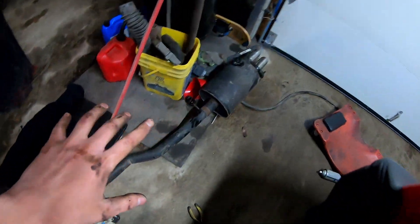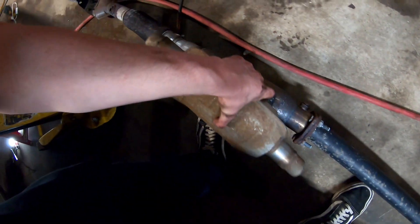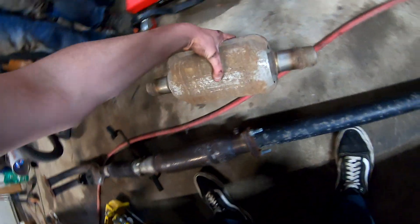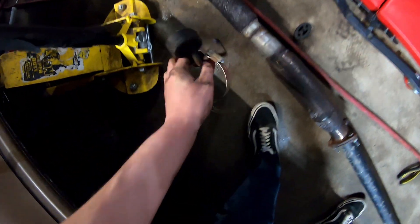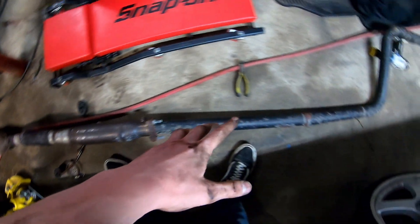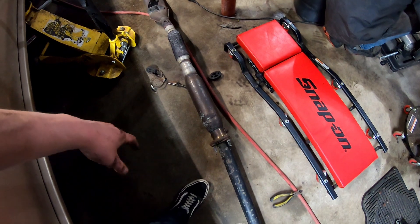The exhaust is fully out of the car. We're going to fix a few little issues while we're at it. This is what we're putting in — and that's actually like the right length, cool. Going to put a cat in — I never thought I'd say that. This hanger was hose-clamped on. Going to make this whole exhaust proper. It had some leaks as well. Getting the cat ready, then I'm probably just going to unbolt the barrel apart.